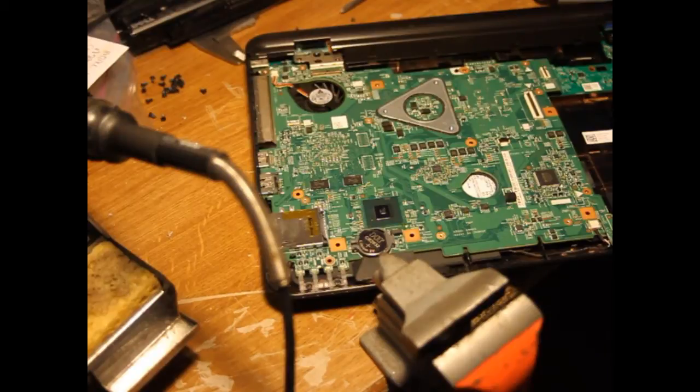Put the palm rest back on and reconnect all the ribbon cables — don't forget that, otherwise buttons won't work or your power button won't work and you'll wonder what's going on. Put your keyboard back in, remembering to plug it in before you set it down. Flip it over and put all the bottom screws back in and it should be good to go. I know there are a lot of tutorials for this exact model, but this was pretty easy — especially if you just buy the board and replace the whole board. Thanks for watching.